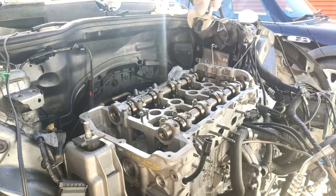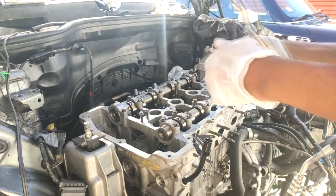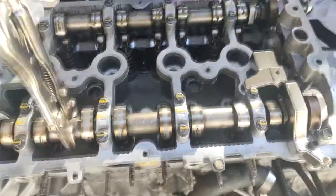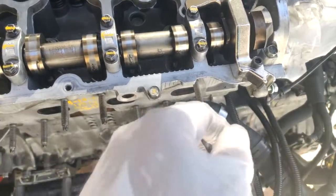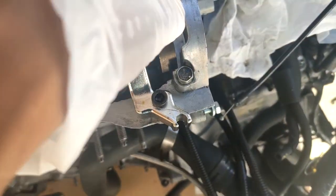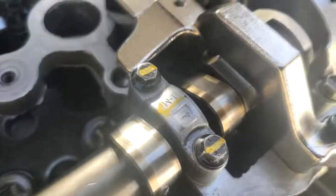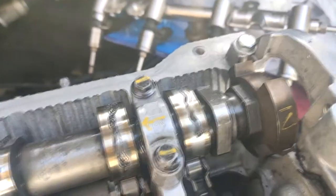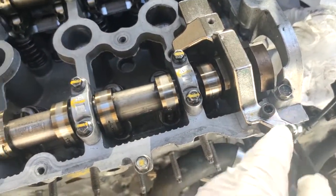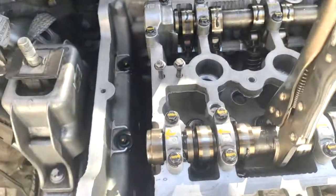It's kind of hard to fit a crescent wrench in here though, that's why I like to use this one. We'll go ahead and put the alignment tool on there. I'm just going to use this vise grip since they already jacked up the camshaft the first time around. Basically these markings have to be facing on top, along with the square end on the camshaft itself. They only fit one way inside the cam holding tool — it looks like a square but it's actually a rectangle shape, so it only fits one way in. Now I've got that one in, we'll do the intake. After that we'll snug these down with the supplied hardware and get the camshaft sprockets in there.